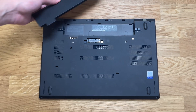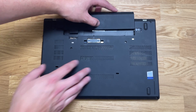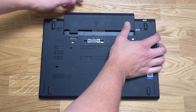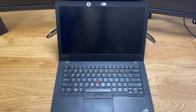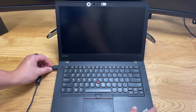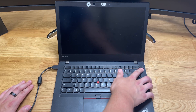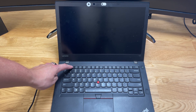Slide the battery pack back in on the bottom by moving the clips to the unlock position and sliding it back in. Because we disabled the internal battery to work on the computer, we need to plug in the AC adapter to power the machine back on. Once the machine boots up, the internal battery will get enabled again, so you don't have to worry about that.